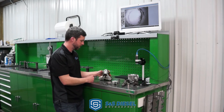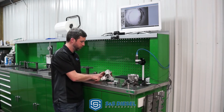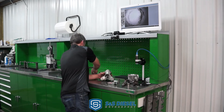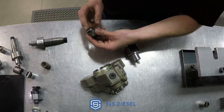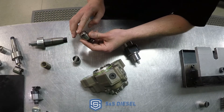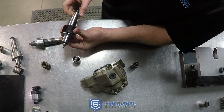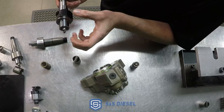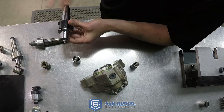The CP3, on the other hand, is a much heavier pump — physically much heavier — with a forged body, three pumping elements instead of two, and a primary difference in the bottom end. Instead of a roller like the CP4 has, it has what's called a bucket with a big foot pad. And instead of a two-lobe cam with an aggressive ramp rate, it has an eccentric on the cam and a polygon that's a separate piece with a wide bushing that spreads the load out.